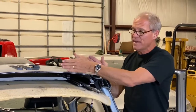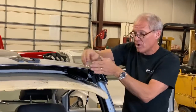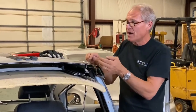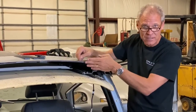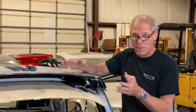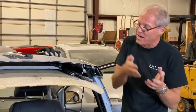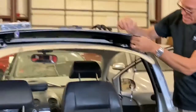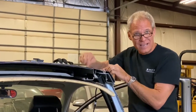You can cut from this corner to that corner along this flat surface without cutting the underlying layer. Our rough cut is an inch rearward from our final cut on the skin. So we're going to cut this outer skin away. Keep this area where the sunroof is sticking out an inch beyond the final cut outer skin.